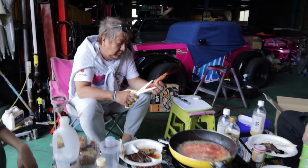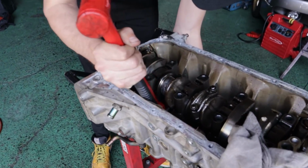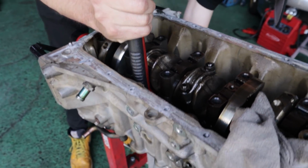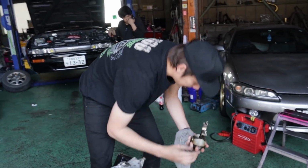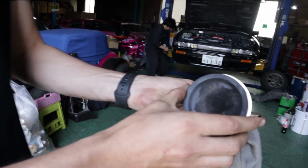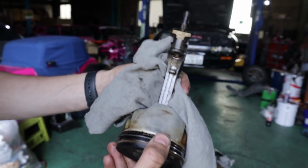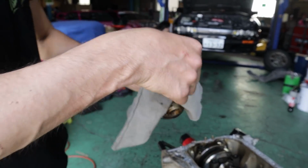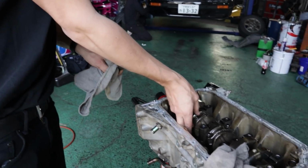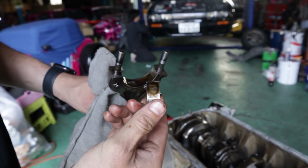Let's go. Finished lunch, back onto the engine, removing pistons. First one is out, and already discovered that pretty much we did have stock pistons in here and rods. So this thing held up really, really well, right on the 400 mark for that entire time. And the bearings on this look amazing. They look brand new. Don't see anything wrong. Look at these, brand new pretty much.